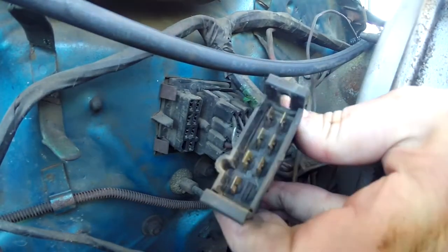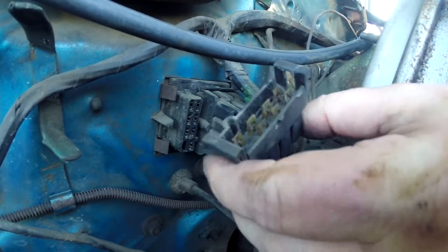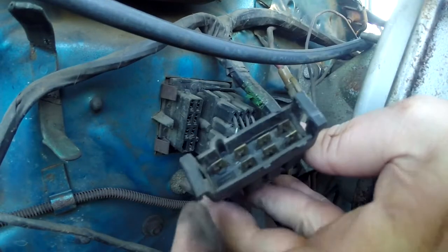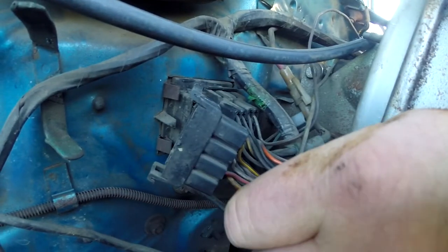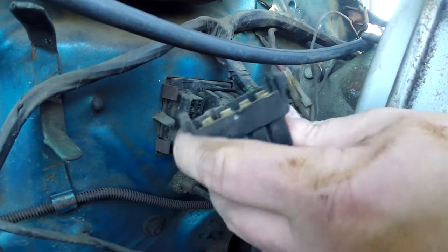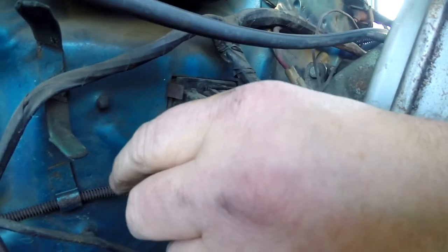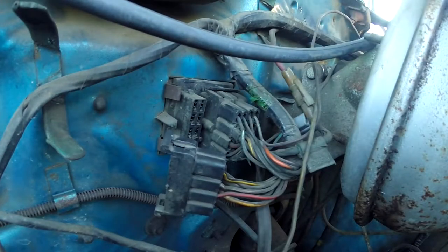You can see it's got these spade connectors in there. I found some replacement ones and I think I still have some, but I don't really like that style. There's a spare hole in there which I like because I can always drill through that and put a nice fat wire through. Once I clean these up, I'll probably pack it full of dielectric grease so that no water can get in — infiltration is sometimes what causes these things to go south.